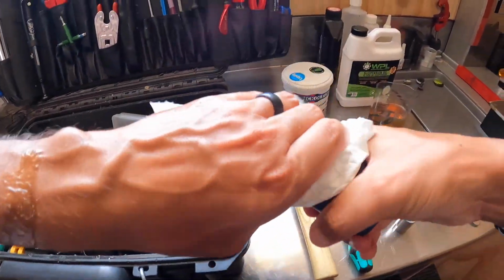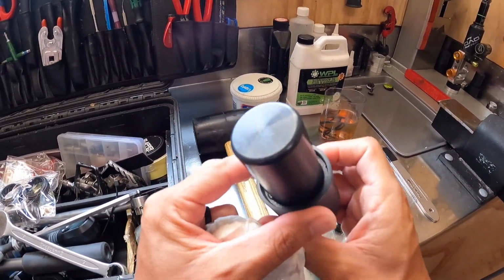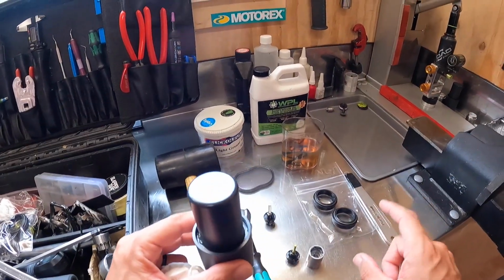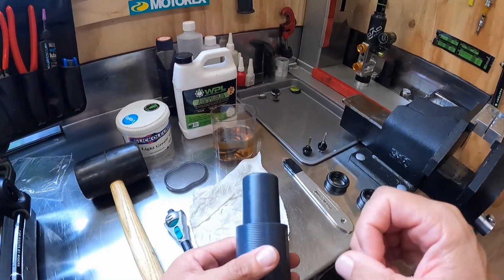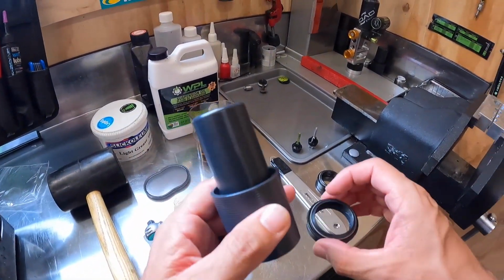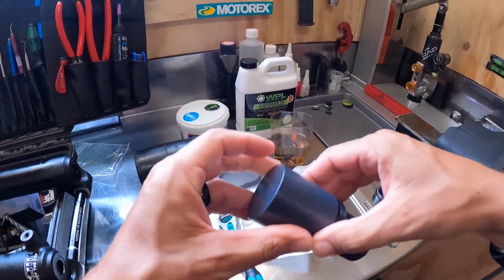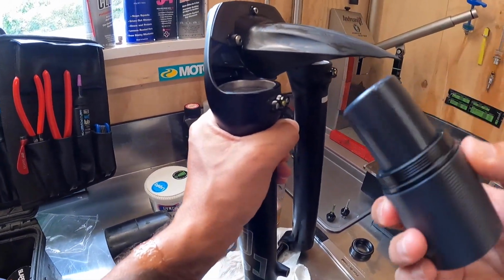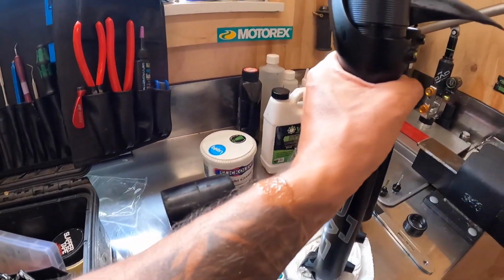And then we just have a 36mm seal press, because this is an Onyx. Yeah, and then we'll go ahead and show you how we press the seals in with this tool into the casting. Right, so we've got our casting here nice and dry and free of water and contaminants. Now we take our seal and we slide that onto the seal press, grab the casting, and then this longer part here lines up with the bushing to ensure that you don't press the seal in not straight.